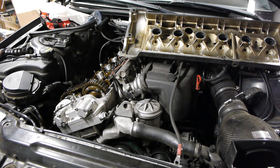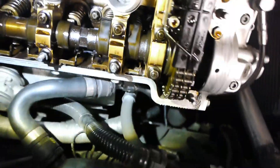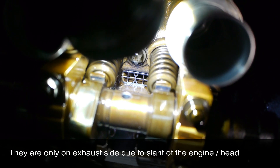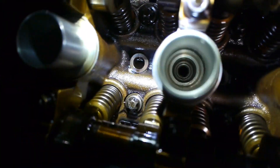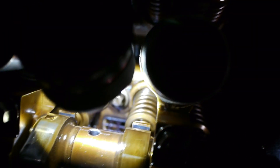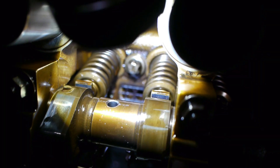I'm going to position cylinder one so the cam lobes are pointing up. For those of you on older pre-facelift cars, you can see right below the bolt there's a plastic-looking grate. I would highly suggest that if you need to adjust the valve, you plug that, because on the pre-facelift car you won't have that rubber or plastic galley cover, and if you drop the shim — guess where it goes.